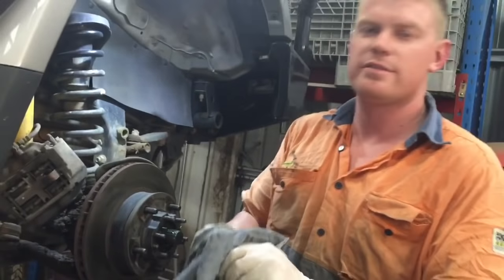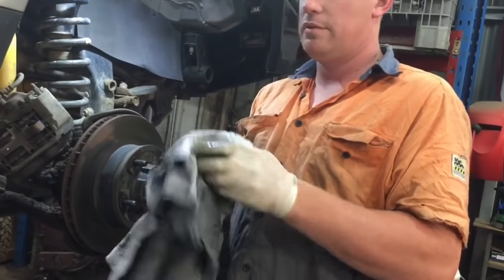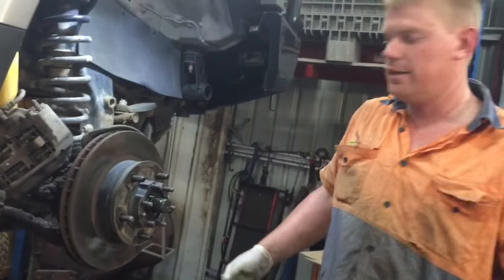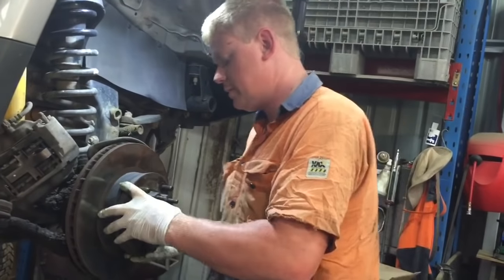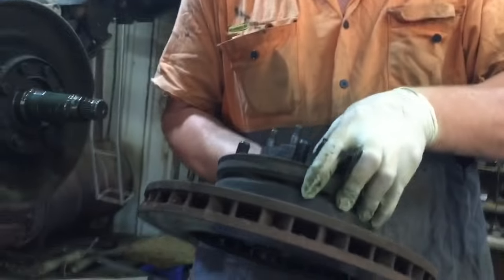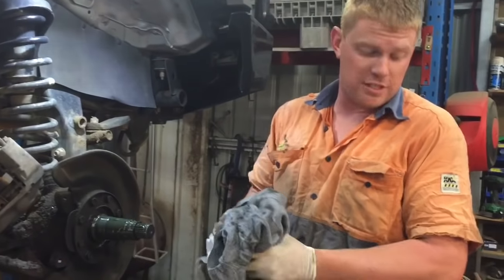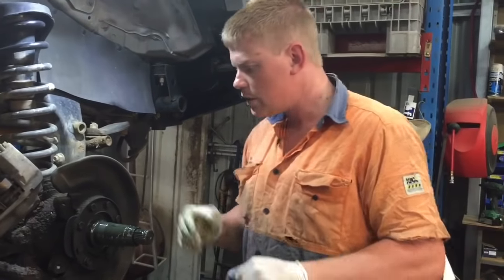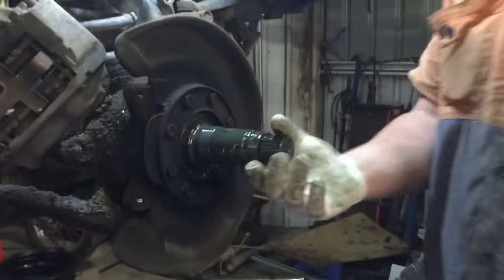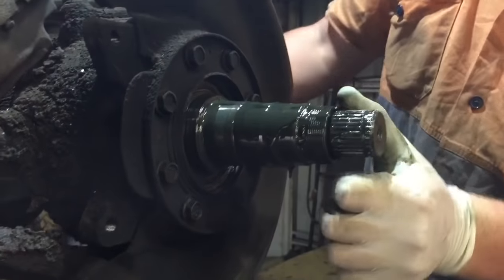Can't show you all my secrets at once. Now obviously I'll do things differently to the next guy — I don't care if you want to do it differently, we're showing you how I do it. So this is the whole hub assembly with wheel bearings, everything intact. We'll put this down and get some more footage of that later when I repack the bearings. So now here we have the spindle. This is actually your CV joint — so when you hear about CV joints breaking, this little bugger here will drive all the way to your diff.